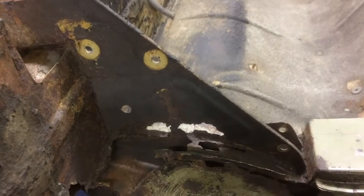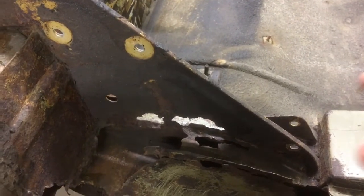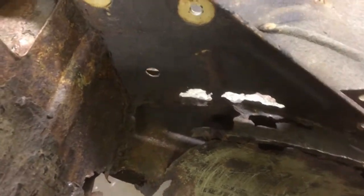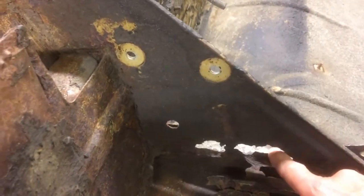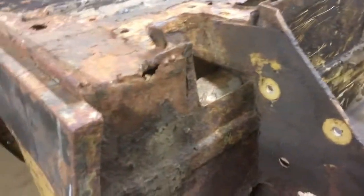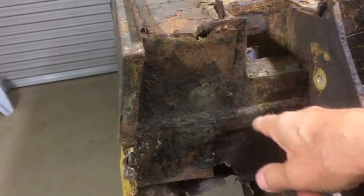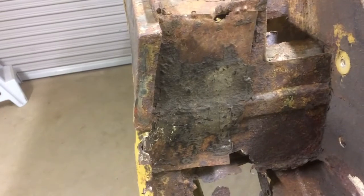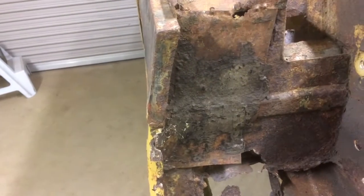Going in a little bit, the boot floor, which sits underneath the shock absorber mount, that's all gone, so that'll need to be repaired, and we'll need to fit a new shock absorber mount because that's got half of it missing. Pointing forward, the rear panel will have to be manufactured and put in place because this is all just a load of patches at the moment.